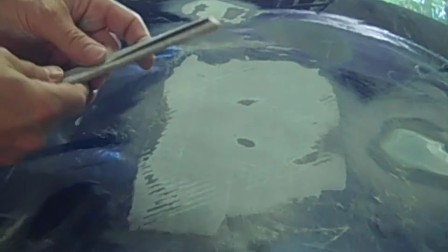The problem is, if you mix it too hot, there's bleaches in the hardener for the body filler, and that can bleed back through your paints and stain your paints eventually. It may not show up right away, but it'll come back later. So that was just all I was talking about in this part here.